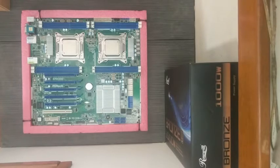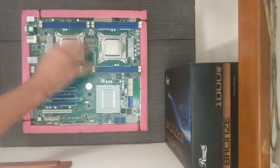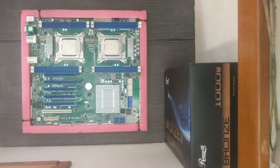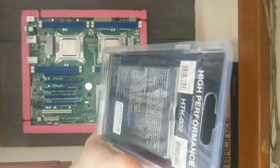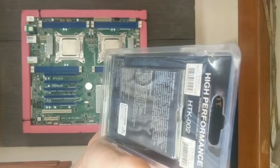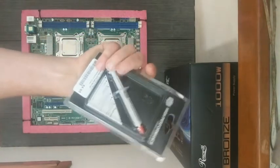Now this grease is highly toxic, as I mentioned, but that's okay. We don't want to be touching it or the tops of these really much at all. The only grease that should be there is this stuff right here. What is this? This is a thermally conductive compound resisting changes in consistency at temperatures up to 177 degrees Celsius, 350 degrees Frankenstein, maintaining a positive heat sink seal, yada, yada, yada. Do not put this in your soup.